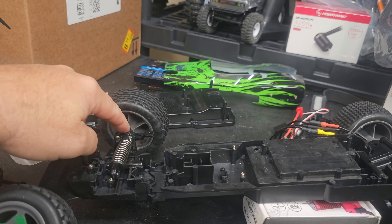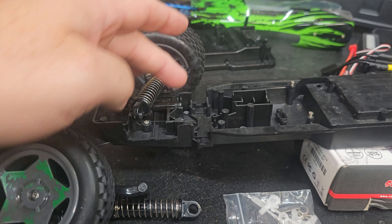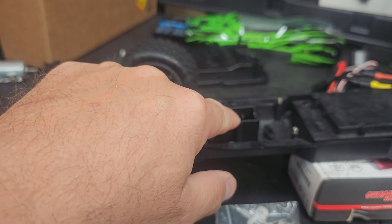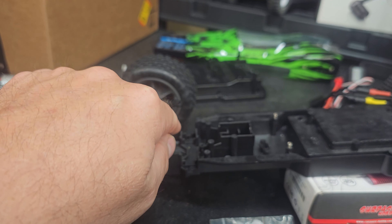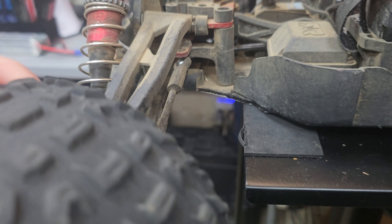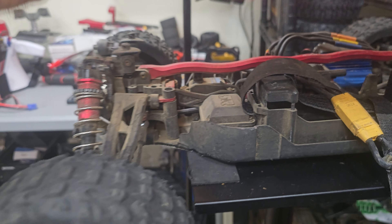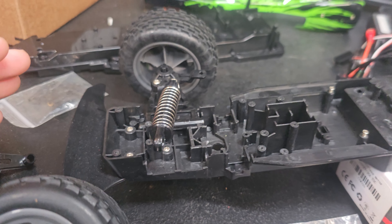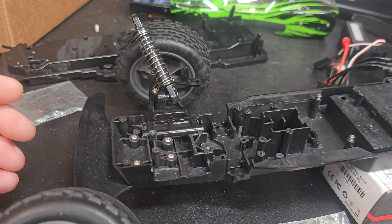This thing's kind of cheap, guys. See how it has the arm that comes back here? The other side does as well, so if you line them up correctly, maybe you can put a bar across there to keep the steering in line, then run another piece over to that arm to make that arm go back and forth — kind of like something similar to what's in the Arma. Maybe I can add something like that, but I would need something like these little towers in order to get the arm on for the servo. I can also 3D print some stuff, but I'm trying to make it as easy as possible for somebody to just switch this over.